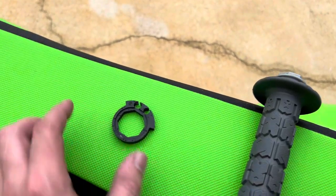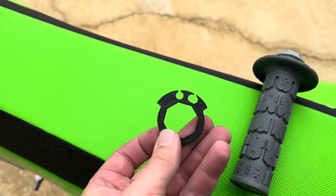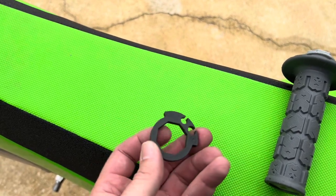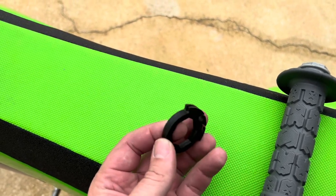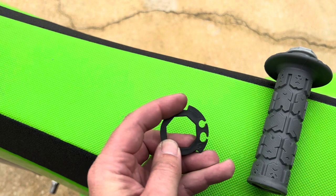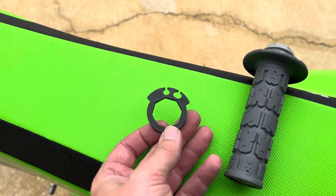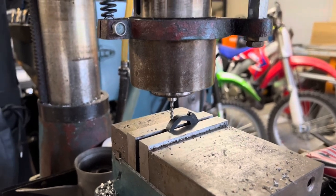So what we're going to do: this is a lock-on grip, and this is the proper cam for the Kawasaki. We're going to modify this cam kind of like the Throttle Tamer. You can do this with a Dremel tool or even a drill with a 1/8" or 3/16" drill bit, or even just a file because it's just plastic. I have a little milling machine, so I'm going to mill it down to make fine adjustments — that'll make the diameter smaller where the cable goes around for the first half of the throw, which will tame the throttle and reduce the pull ratio.